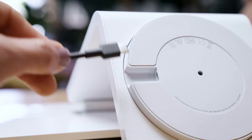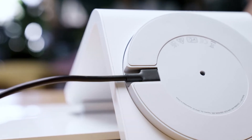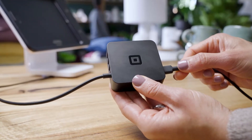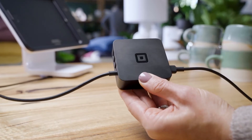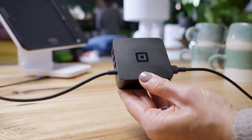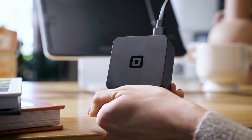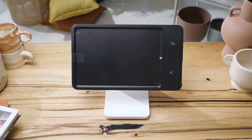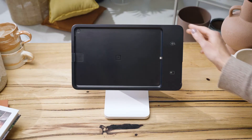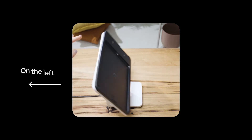To power up, connect the USB-C cable that's attached to the hub into the base of the stand. Then grab the power adapter and connect it to the hub. If you're not using the hub, simply plug the power adapter directly into Square Stand. Next, plug one end of the power adapter cable into the power adapter and the other end into a power outlet. Square Stand can swivel either way. For clockwise, have the hub or power adapter's USB-C cable exit the base on the right. For anti-clockwise, have it exit on the left.